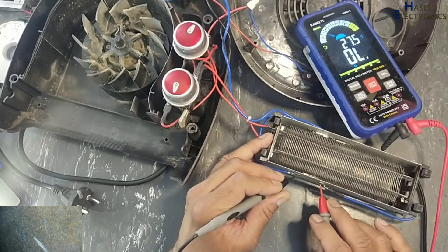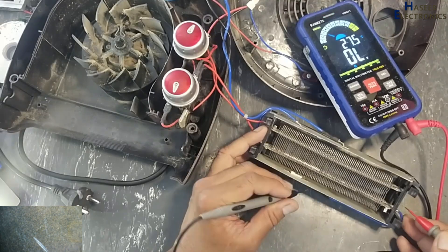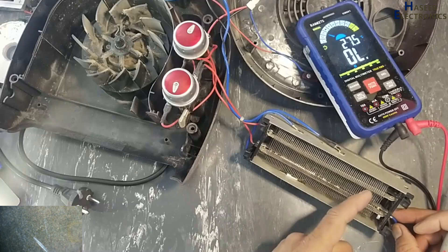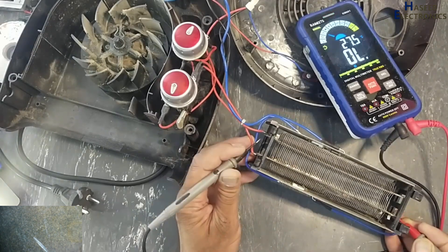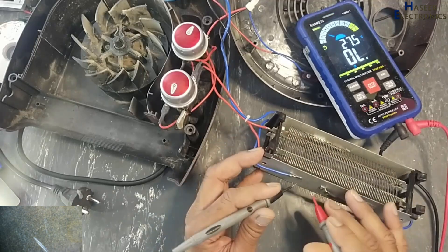This is our problem. Then this wire is reaching here, so common is provided to both heating elements — high and low. The first heater is good, the second heater is good. The problem is here, at this thermal switch.